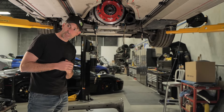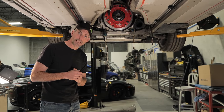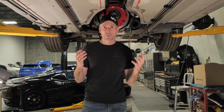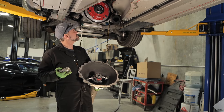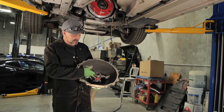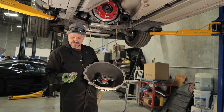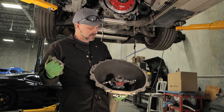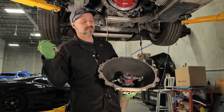At that point we've got some new rubber to go on the car — the current tires are pretty old and worn out. Once that's done we should be ready to go to the dyno and compare it against figures we've seen on stock Vantages on the same dyno, which should give us a good reference for how much power this car is actually making. We've installed the new aftermarket clutch and just finished shimming the slave cylinder, which is quite crucial — you want to get your depth right for your pedal play. We've taken just a little over a millimeter out from original and we're going to see how that works. Next will be installing the torque tube, driveshaft, and transaxle.